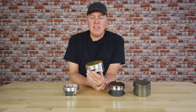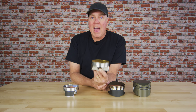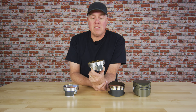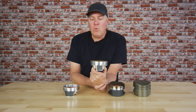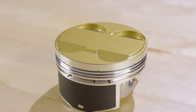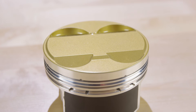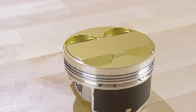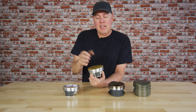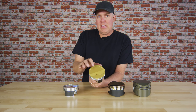Next up, this is a JE Ultra Piston — a new shelf design piston packed with features for guys who want to do big boost on something like an LS engine, which is what this is right here. Part of the features they come with is, first, a ceramic coating on the top. This is a thermal coating. When you're running huge boost — trying to make like 1,100 or 1,200 horsepower — you can localize heat into the aluminum of the piston that can actually change the structure of the aluminum itself. This is designed to prevent that and reflect some of that heat back into the chamber to protect the piston.